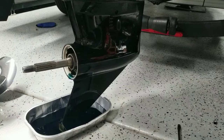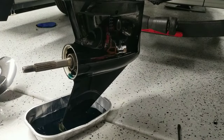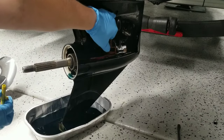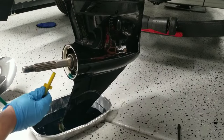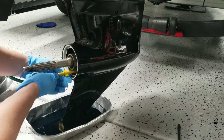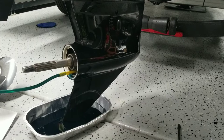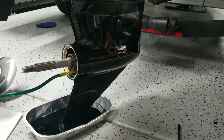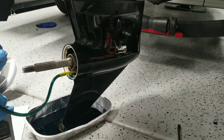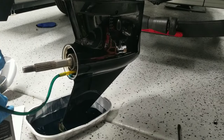I'm back and this thing has finally drained. We don't put our upper plug back in yet. What we're going to do is attach this little outlet to the drain plug hole and pump gear oil in until we get fluid coming out that upper plug. This line is kind of stiff — hold on to the line kind of like you do with the tube for the oil drain. We're going to screw this in just a few threads and start pumping gear oil in — this refills the lower unit. We're going to keep pumping until oil comes out that plug hole up top.